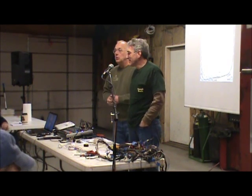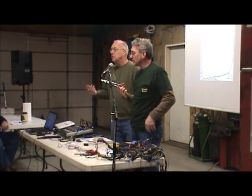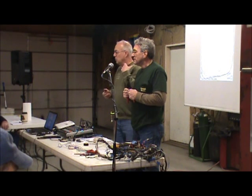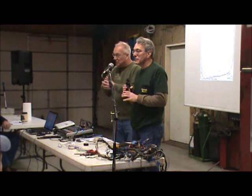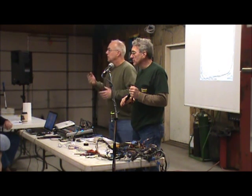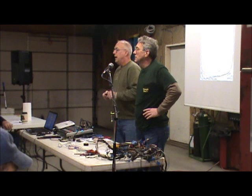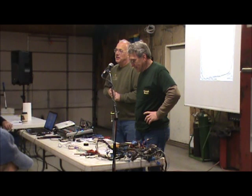Going back to the tool, I used a pair of channel locks and I still use a pair of channel locks. I've done it forever, and it works very well. We do sell a tool. British Wiring has a tool that'll actually help put the bullets in the sleeves, and it can be a pain in the butt. There was a problem probably 5 years or so ago that the actual bullets were just a hair too big, and you'd try to put them into the sleeve. It wouldn't work. It was a pain in the you-know-what.